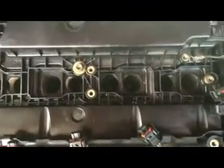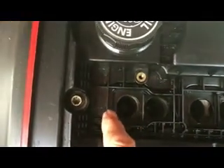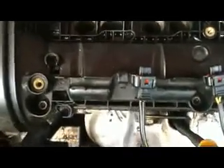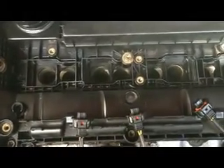Having removed the coil pack and disconnected all the spark plugs, two or three of the spark plug holes have oil around the plug. The left-hand end is clear but there's oil further down around the middle ones. If the oil was from overfilling or spilling from the plug entry it would have gone into those plugs and it hasn't, so the oil is obviously coming from the camshaft cover. I'm going to need to take off the cover next.